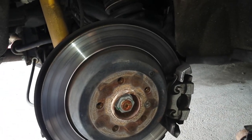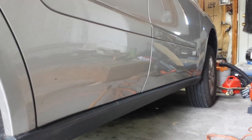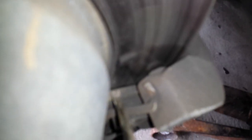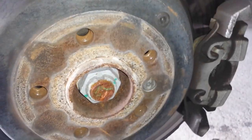I took off both fronts of the vehicle and checked those pads — they were fine, and the sensor was fine. So I came back and checked the rear, and if you take a close look here, you'll see that the pads are pretty low to non-existent back here. These pads are end of life. On the right side of the vehicle is the wear pad sensor, right here — I'm going to be replacing this, as well as the brake pad.